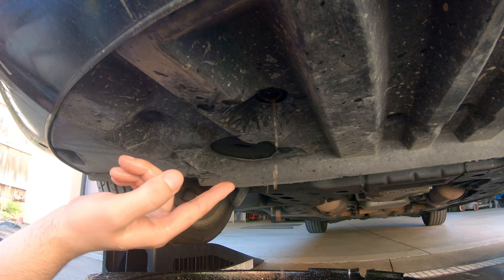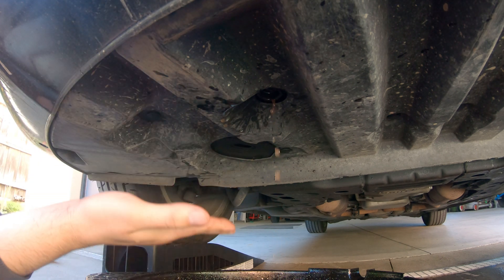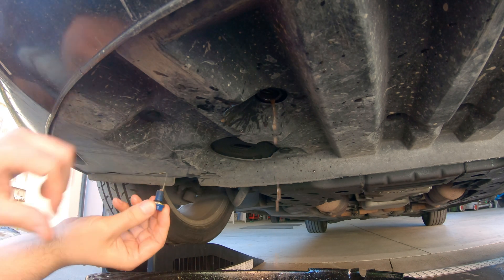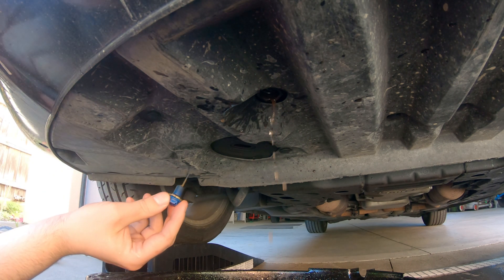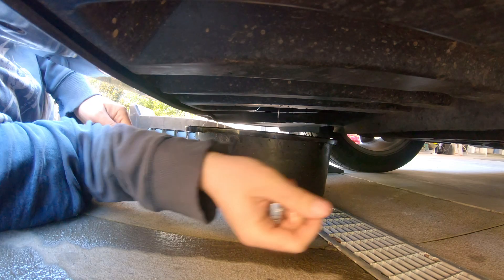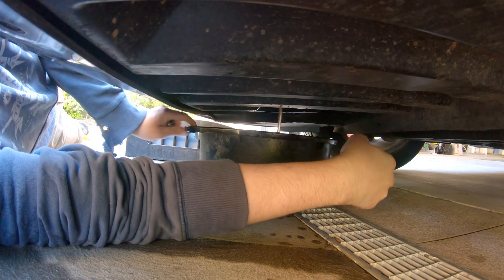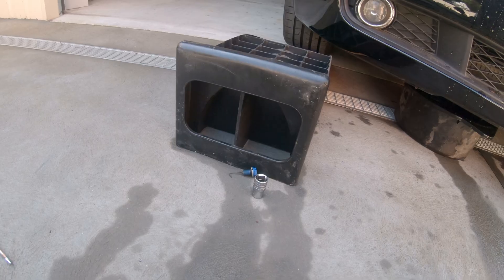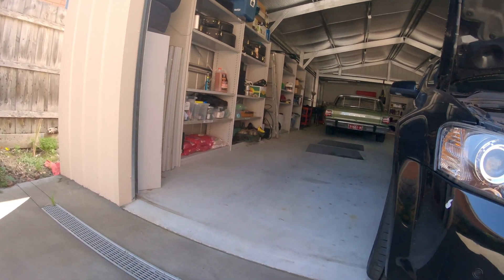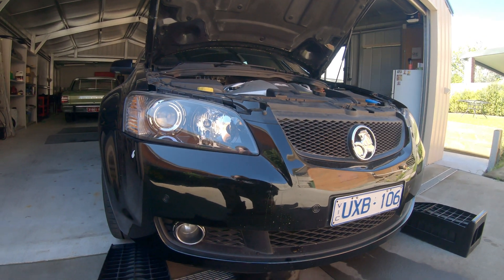What I'm going to do is plug this up and then put the car back on the ground. I think I've got enough clearance between the vehicle and the plug to do this on the ground, and it might actually get us some more liquid out of this thing. So we'll plug her up and put the flusher in, and let it run for the prescribed time and see what happens.